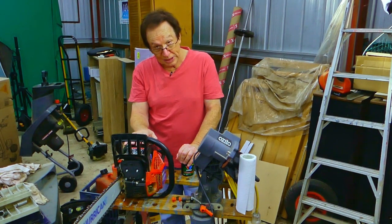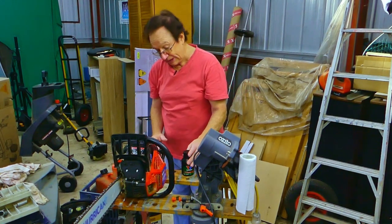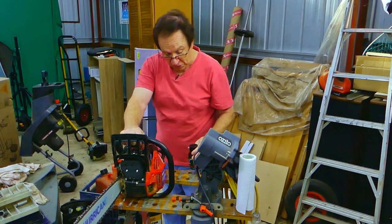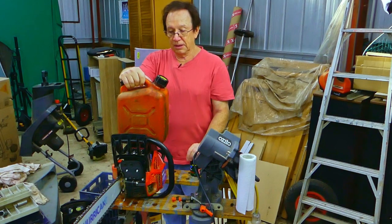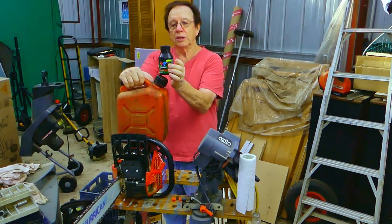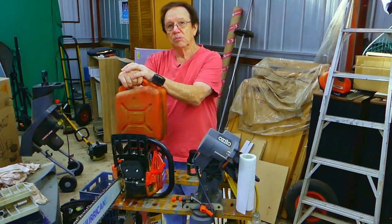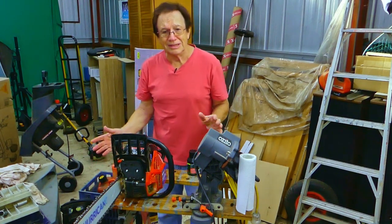And we ran out of fuel. That's why we stopped. And so tomorrow we'll be going to get fuel. I've been to the supermarket and I got some two-stroke oil and it's at 25 to 1. This is the ratio. And it's really easy because what you do is you get your 5-liter imperial gallon container and your 200 mil of oil comes in the bottle and you just empty that in there. Then you fill it up with unleaded and that's your fuel.